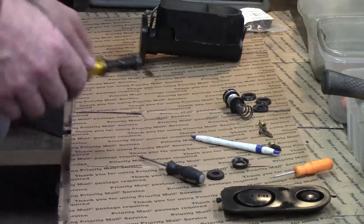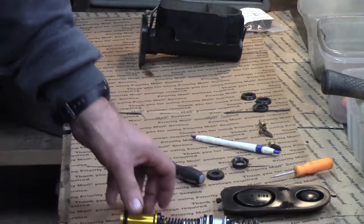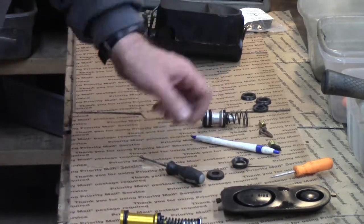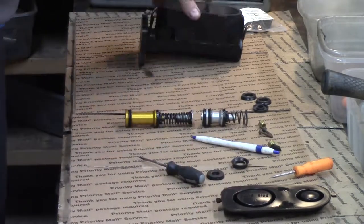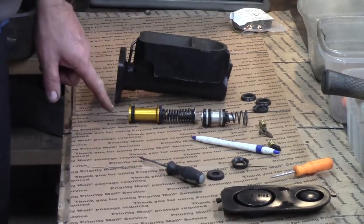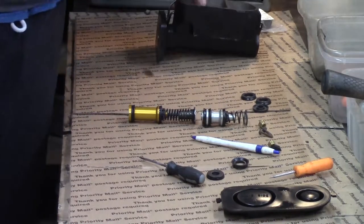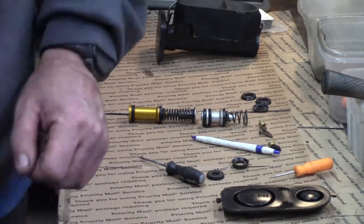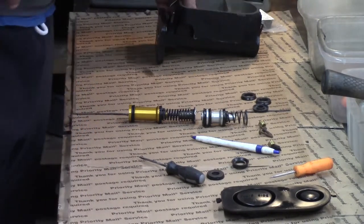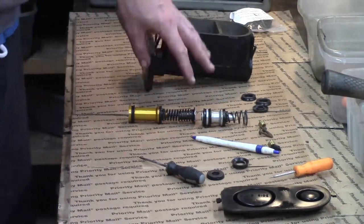So there's how our two pistons go in. This is the front piston closest to the front, and then the rear piston is right there, which has most of the fluid. Now, you all talk about proportion valves and all that — there ain't no proportion valves or pressure reducers. All the proportioning is actually done in the master cylinder, the size of the pistons and the volume.